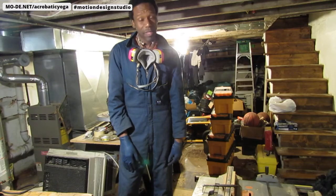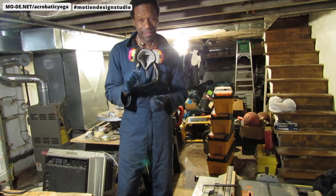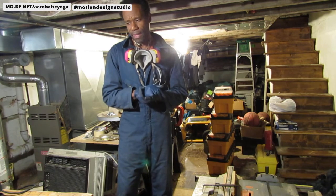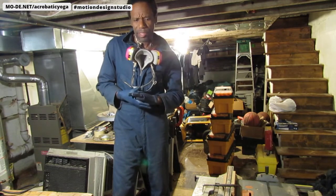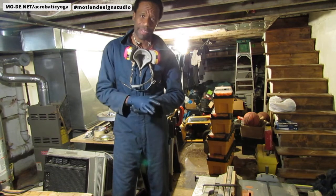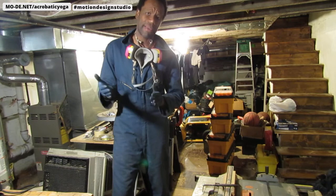All right. I hope that you liked that video on how to repair the power switch on your Bosch 1617 router. Again, it's a common problem with these routers that dust particulates get inside of the power switch and cause it to not connect anymore. If anything fails, you can try to fix it the way I showed you. Other than that, Bosch apparently does a really good job of their product support, so you can send it to them, they'll probably replace it for you and give you some upgrades on the bushings. And if you heard my router, you can tell that the bushings are also failing, so I need to also replace those things. Maybe I'll make a video on that.